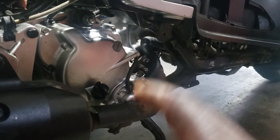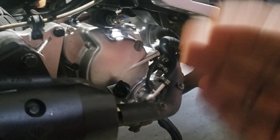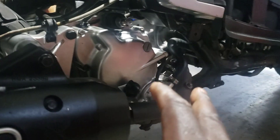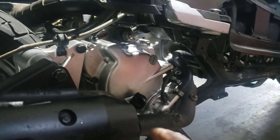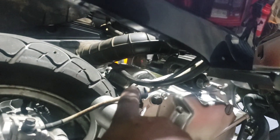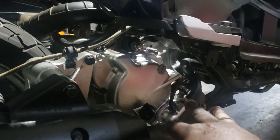I went to an auto parts store to get a universal keyway that somewhat fit. I did some cutting off camera and got it all together and in there. But something happened with the flywheel — I got it on there nice and tight, everything seemed fine, but for some odd reason everything was completely locked up. I couldn't even turn it over or use the crank on the other side. I thought for the longest time it was my starter, so I ordered a new starter, but when it arrived the starter didn't fit. I couldn't figure out what was wrong, so I had to take everything back apart.